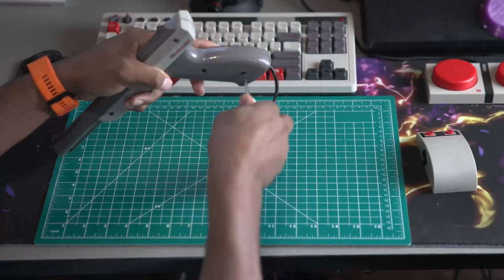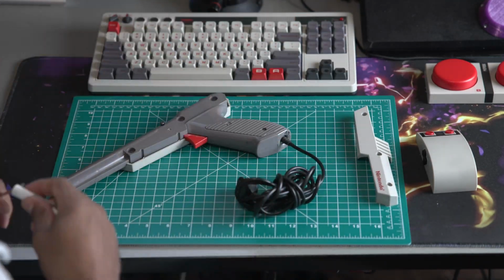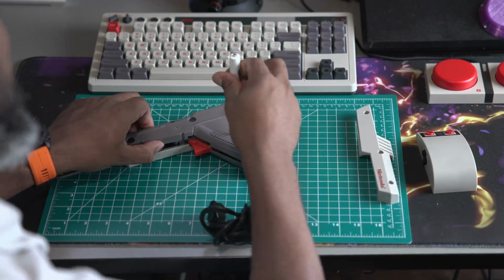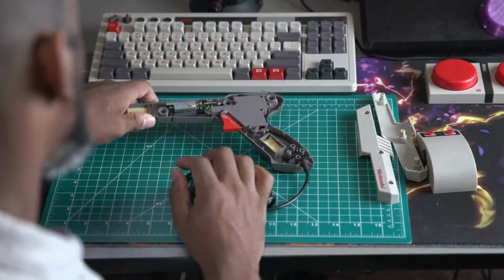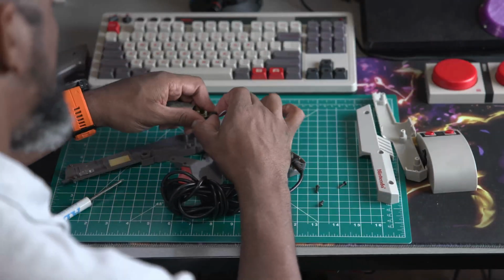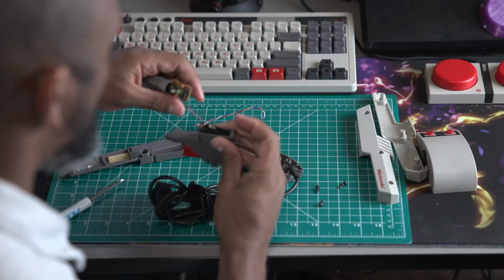The Nintendo Zapper has about 6 Phillips screws and 2 flatheads. 3 in the outer light gray bezel, and then 1 under the bezel and 2 in the handle. And then there's also 2 flathead screws in the barrel. Once you get that part disassembled, the interior housing, there's 2 weights. Then there's the trigger assembly with an Omron switch and a photo sensor that actually senses what's going on the screen. We're going to disconnect the proprietary Nintendo cable here and put that to the side because we won't need it for the next part.